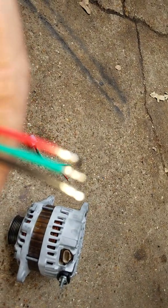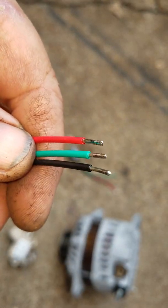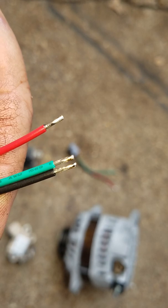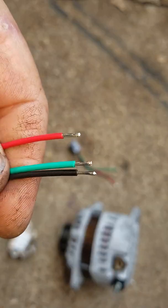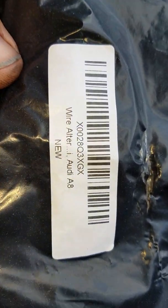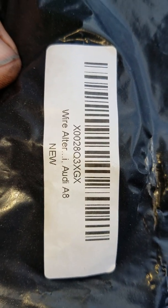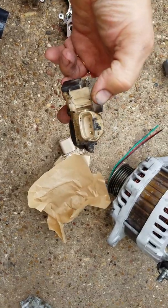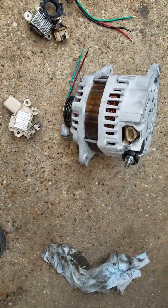If you look closely right by the insulation — these are pre-tinned or silver-coated wires. The whole wire from end to end is coated from the factory. I tinned them with solder because when I crimp it all up together I want it to be really nice. The rebuilder referred to that as the premium plug. When I ordered off Amazon, this plug fits a lot of different models — this one is for a 2009 Nissan Murano, and the bag says Audi 8 which is probably the same regulator assembly. This part number is used on lots of different alternators.